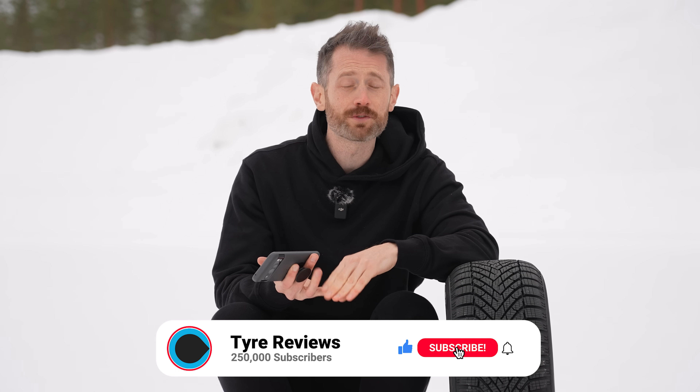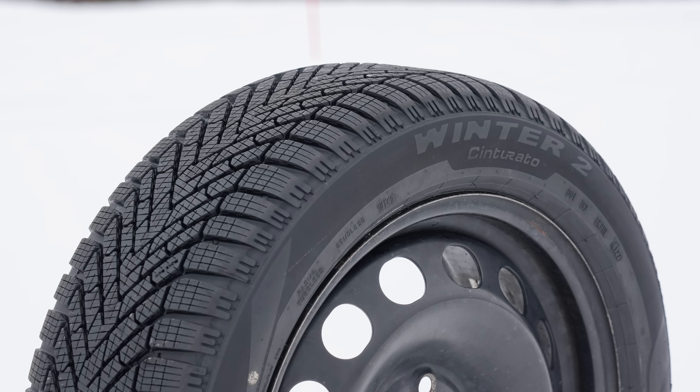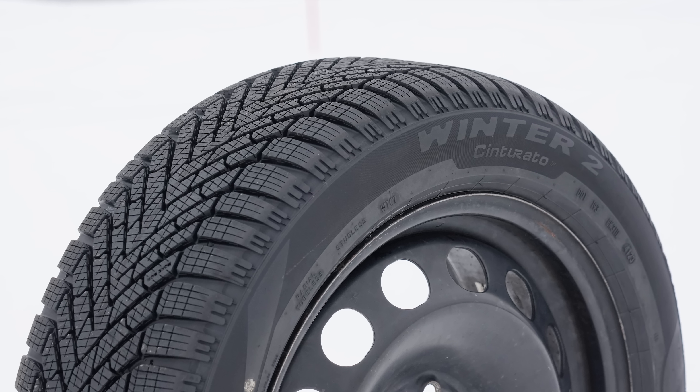Let me know your own experiences with tyre pressures. We've pretty much solidly proven that lower pressure is the better pressure. However, don't go down to 10 PSI — it's not worth the small advantage over 20 PSI, which seems to me the sweet spot in everything. The risk of damaging your wheel, damaging your tyre, popping the tyre off the rim and getting stranded just isn't worth it. Dropping down to 15 or 20 PSI will give you traction advantages if you're at risk of getting stuck. Make sure you re-inflate your tyres afterwards because you'll get serious uneven wear on the outer shoulders at such low pressure. A huge thank you to Pirelli for supporting this test. Any questions please ask below — safe motoring.